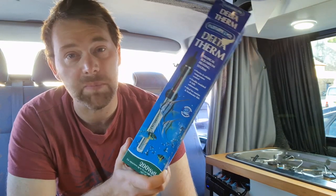Our heater for our water is a very simple system. There are a lot of systems in campervans that allow you to heat water, but most of those relate to instant heaters, things that run off gas, Propex heaters, things like that. There's very little out there in terms of using electric. You can get immersion heaters for caravans at around 450 watts — they do work but you're looking at about £150 for most systems. We use a very budget system and I'm going to fit another one today so we get two running side by side. The system we use is no more than an aquarium water heater. I've had one of these in the van for about three years. It just sits in the bottom of the water tank and they are 200 watts each.